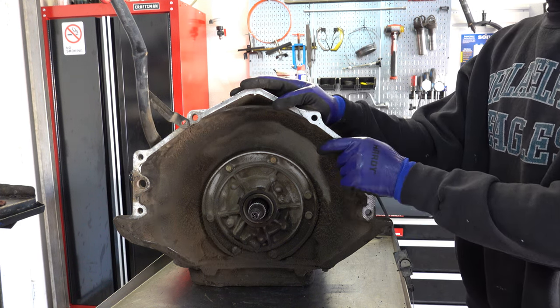If you're going to be doing a lot of real high RPM, like street strip racing, things like that, you may want to install a billet rotor. These are powdered metal rotors, and with real high RPM, especially if the converter gets worn out where the lugs go, you can get a lot of chatter, and eventually these lugs will shear off. It's also common to have these lugs get sheared off upon reassembly because the converter slips off the end of the stator and the installer doesn't catch it. And then when you go to fire up the unit, you get basically no movement, no line pressure, and the pump's dead in the water.